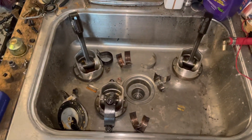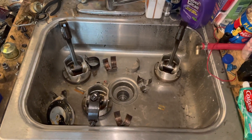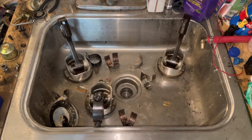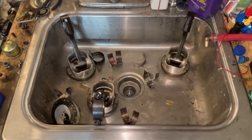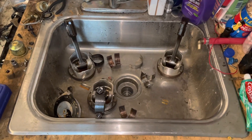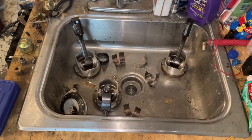That's a motor ruined by poor quality gasoline, low octane gasoline, or bad ignition timing. The owner assures me he was using premium gas for as long as he had the boat, but this is a two-owner boat — maybe the previous owner didn't use premium. It's also got a funky ignition system: a combination of a General Motors MEFI electronic fuel injection and a Thunderbolt distributor triggering that system. I haven't come across that before and I'll have to do a little research to figure out how it works.